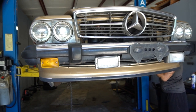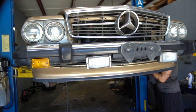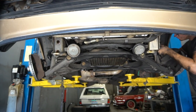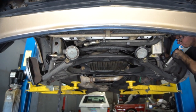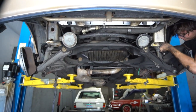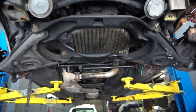The front subframe is a four-cornered, sort of inverted table that holds up the engine, transmission, and front suspension, and bolts up to the body of the car. This subframe mount goes between the subframe and the chassis of the car. You can see it sort of inside the mounting point between the engine. If you're looking in the front left or right wheel well, you'll see it when you look inboard toward where the engine is — the body of the car, the subframe, and this mount goes in between.